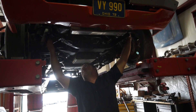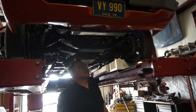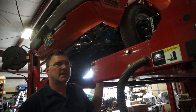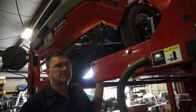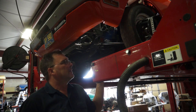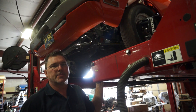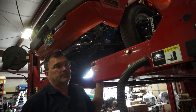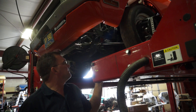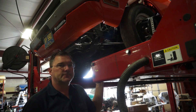There's that noise — it's that guy creaking. We'll make sure we lock him down so it's ready to pull off the lift and take out on the street. I think it'll be a lot better. I found a lot of loose components, a crazy offset on caster, the camber was offset, and the toe was toed in severely. We were able to clean up a lot of little things. I clearanced the upper control arms so they have proper travel without binding against the unibody, and installed the idler arm which gave more rigidity in the center link. Set the toe, and I'm going to make a quick adjustment to the steering rod to take up a little bit of play, then we'll take it out and see how he likes it.